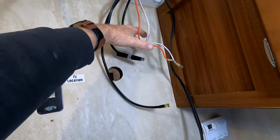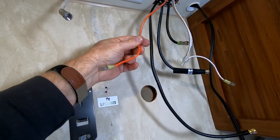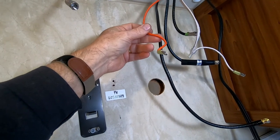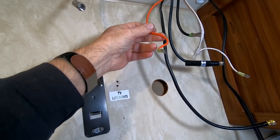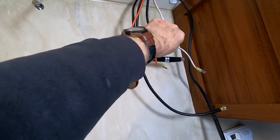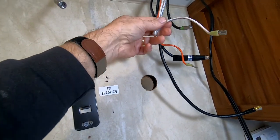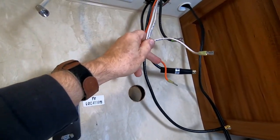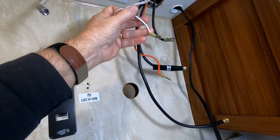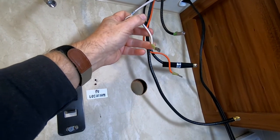That only leaves us with these wires. This one — orange, I think it's supposed to be red, but it's really orange — is the plus 12 volts DC. I showed you where that connected, and I'll be putting it back on that same gold colored lug. This, on the other hand, is the ground. I've mentioned in previous videos that in travel trailers and some other places, ground is normally a white wire. So I'll be putting this connector back on the silver colored lug on the printed circuit board. That takes care of all the connectors.